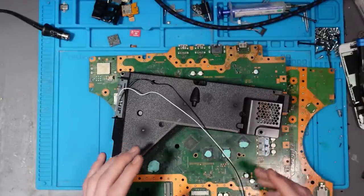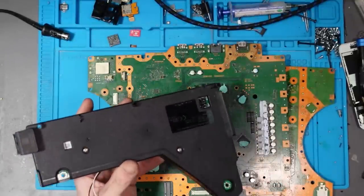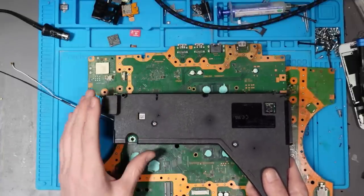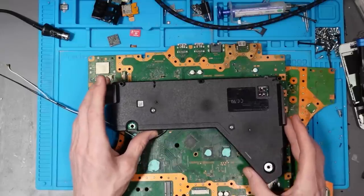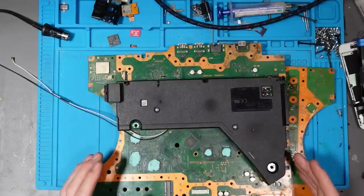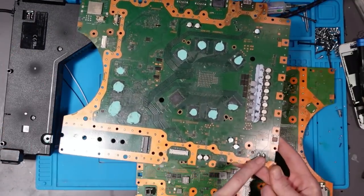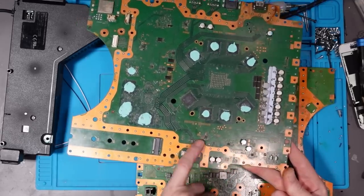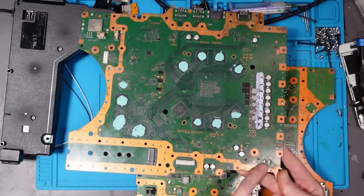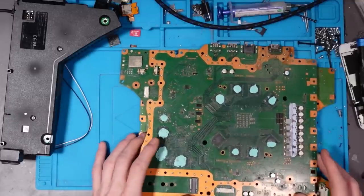I don't recommend repairing the power supply unless you're experienced or have no other choice. The power supplies are going for a premium — on average around £110 which is about $150 US — and they are hard to come by. The symptom is no power at all, the console won't even attempt to turn on. Using a multimeter while the power supply is plugged in, you can test the 12 volt input point. If you've got no 12 volt input while it's plugged in then the likely issue is the power supply, and replacing it should normally fix it.